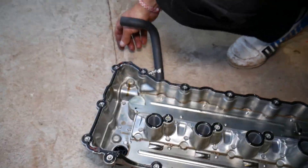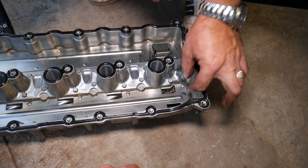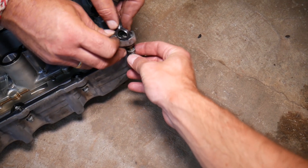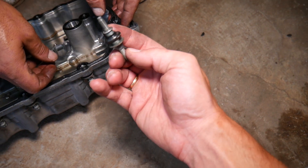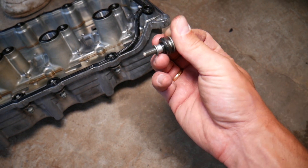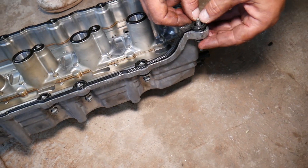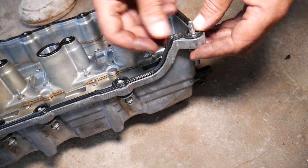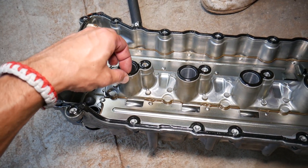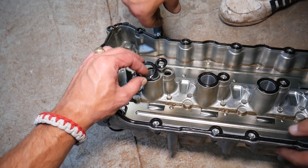When you're about to install the new gasket, pull the old one out a little at a time. The bolts will drop once they come out of the gasket. You can also replace the bushings on the bolts if you want to avoid leaking — most of the time they won't leak, as those are just to keep pressure. We'll go ahead and order ours today; you can find the link in the description below. Don't forget to also replace the one in the middle for the spark plug wells.